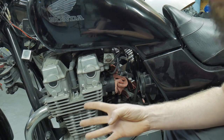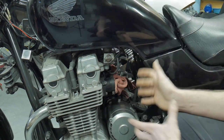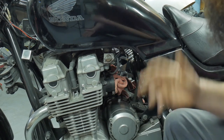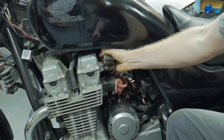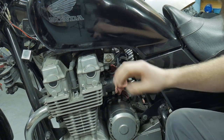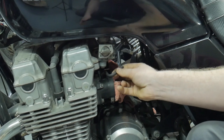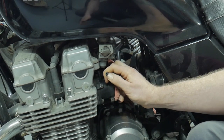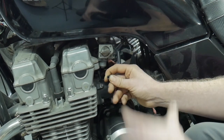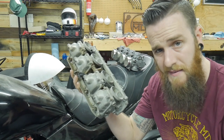I don't think I need to tell you which one will last longer or how many cheap ones you'll go through. Even if you have to buy four to meet the price of one Honda, you can do whatever you want — but I would get the OEM vacuum-operated system if you can. If you're going into the carbs and you know it's been sitting a while, just replace this vacuum-operated fuel valve. The diaphragm, spring, and plate are available as a kit — I'll put a link in the description below. Also make sure you replace the vacuum hose. It may look good, but if you pinch it and it's stiff and hard it's gone too long without replacement, and most of the time they develop spider-like cracks on the tips. Just replace it and mark it off the list.